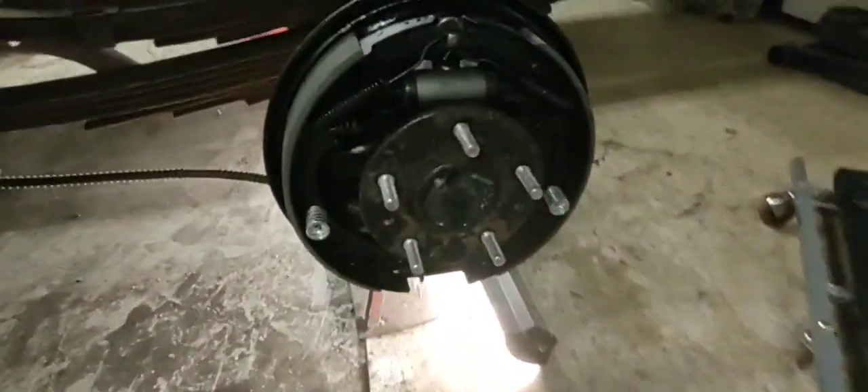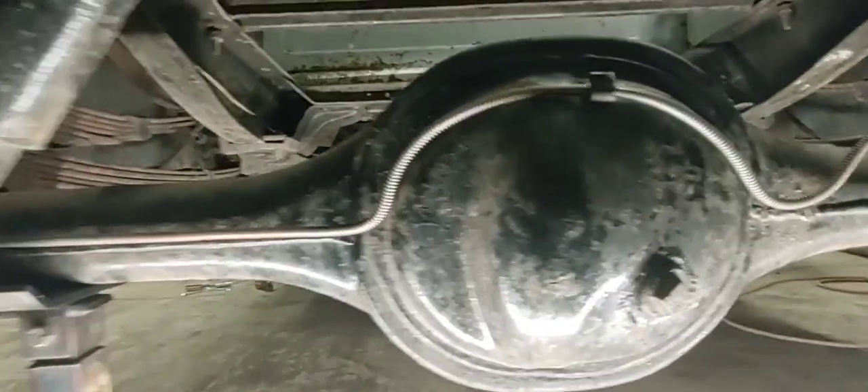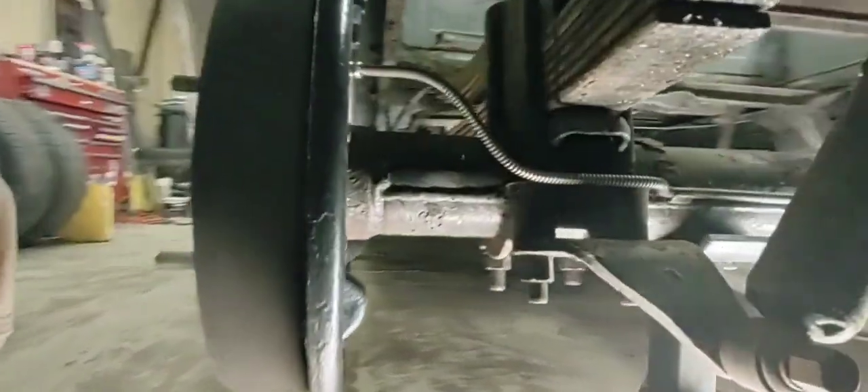I've been hard at it - I got the brakes all put together on the back. Got the e-brake cable all hooked up, the brakes all done up, e-brakes hooked up too, all greased up, wheel cylinders hooked up. I'm gonna get my drums back from my buddy. Under here I got my brake lines made, running over and snapping the rear end up on top, goes to the T, and over to the other wheel cylinder with that gravel guard on it. Got to tighten them all up before I go to bleed them. Also ordered a vent tube for the top of the rear end - the vent was missing.